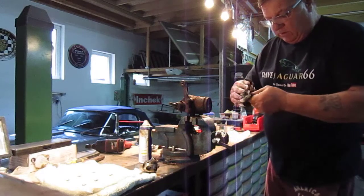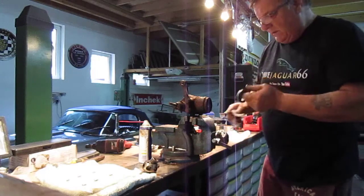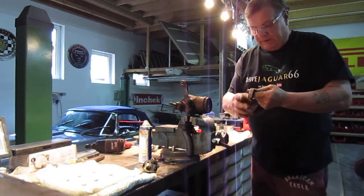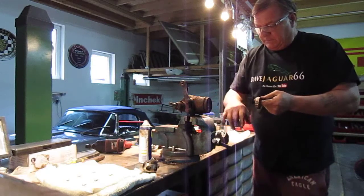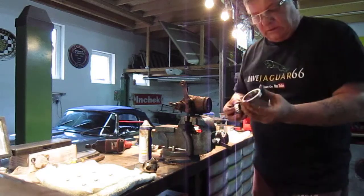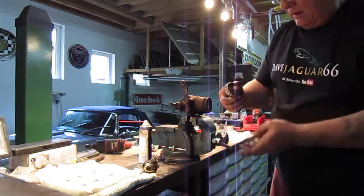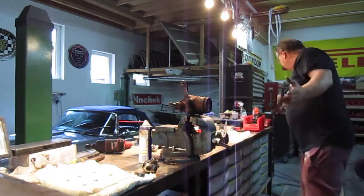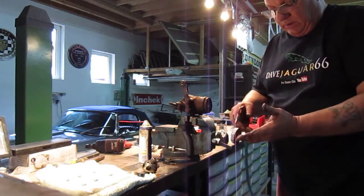Now, just a quick one on bearings. Again, I don't want to teach anybody to suck eggs, but these bearings are tapered roller bearings. They have the roller bearing itself, and then I'll just show you here, and you can see they're on a taper. So getting a bearing and dropping it in cleaning fluid is a good way of getting dirt out of it. If you want to get all the crap out of it, you can do it.